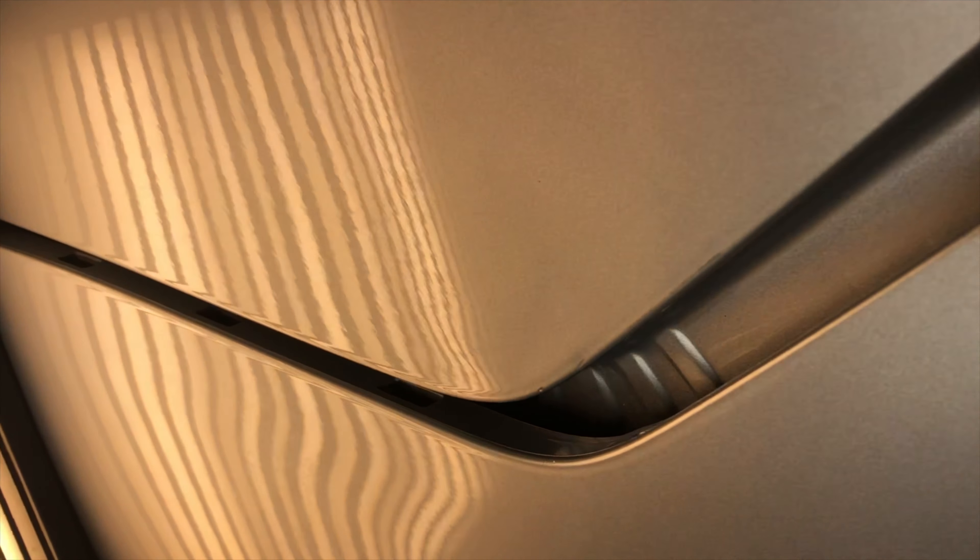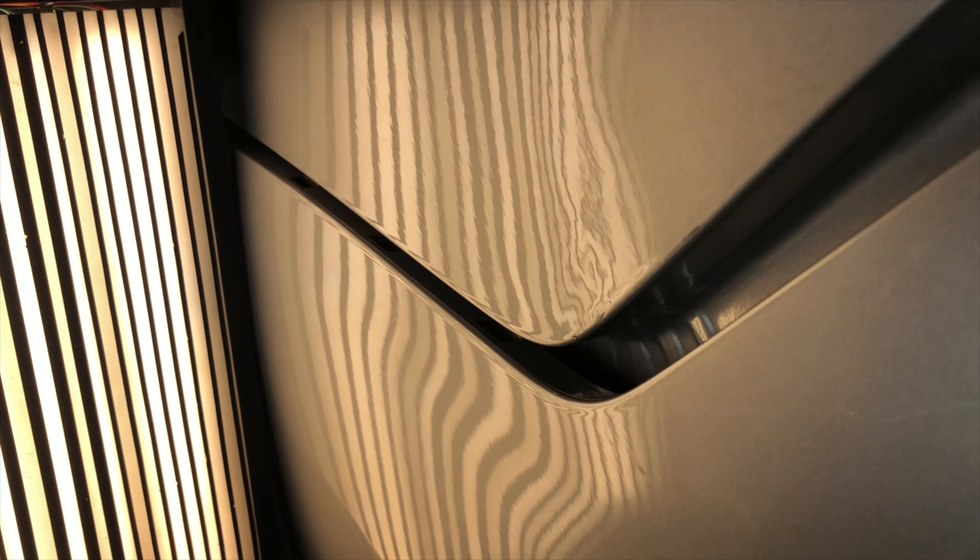I'm about five to ten minutes into this repair, trying various things like a little bit of a glue pull. I haven't tapped it down yet, but the hardest part of this kind of damage is right on the edge. There are a couple of ways of going about repairing it — you can strip the inside quarter out and use something like a plastic dolly to knock the edge out, or you can tap this edge up which will take the stretch out. That little bit right on the edge is probably the hardest part of a dent to repair. There's no point trying to repair any of the rest, even the bulge, until that bit is out — so that needs to be done first.